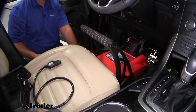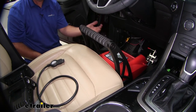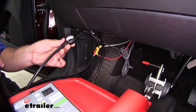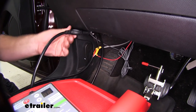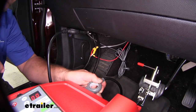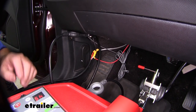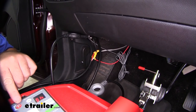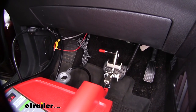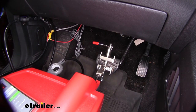Move your seat up to no farther than a quarter inch from the handle — I like to actually touch the handle myself. Then connect the wires: connect the black end into the plug and the gray end goes right into the front of the BrakeBuddy. Once you plug it in, you're going to hear it purge. It's going to say 'bleed brakes.' Push the auto start and it's going to apply the brakes. Once it's done, it's going to say 'normal' and the purging will shut off.